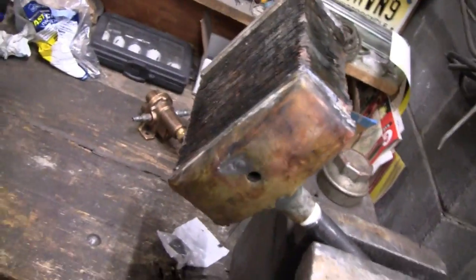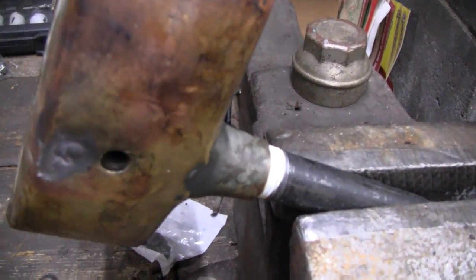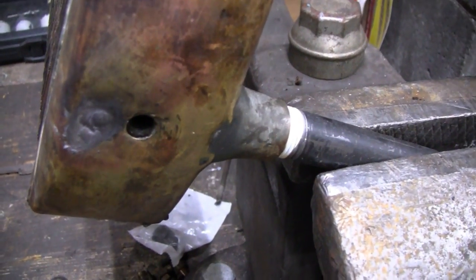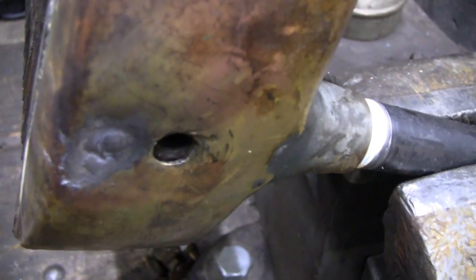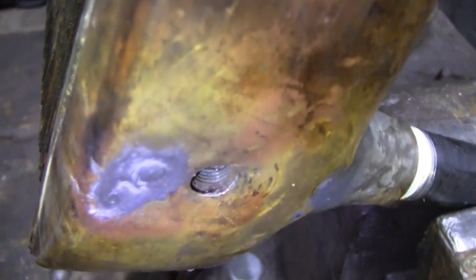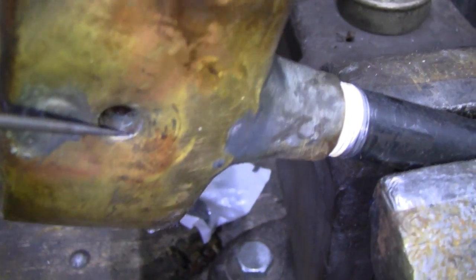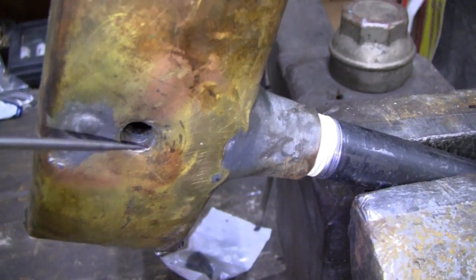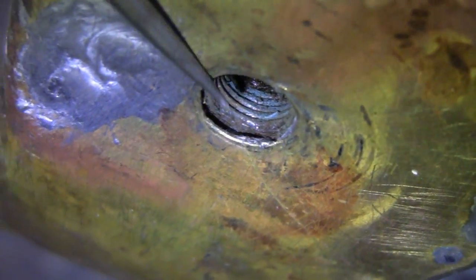Let me draw your attention over here to this radiator. If you remember last time, we had a problem with this hole leaking. I tried all kinds of sealants and tapes and stuff. And one of my subscribers mentioned something to me — he actually told me twice. Let me put my light on so you can see. It actually wasn't the threads — these threads must be mounted in there with this rivet, and it was between these threads here. Look at that big gap.